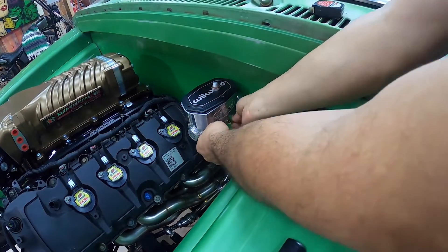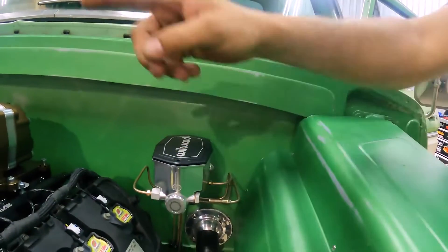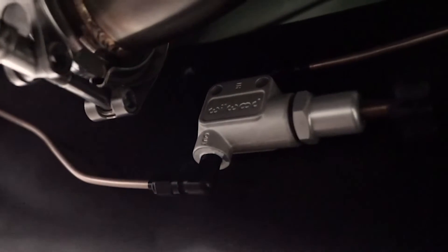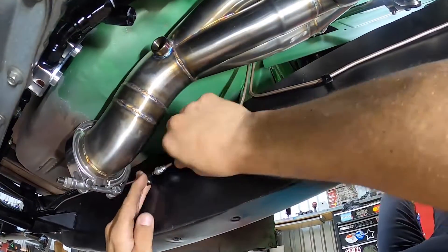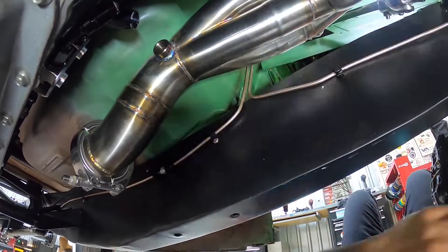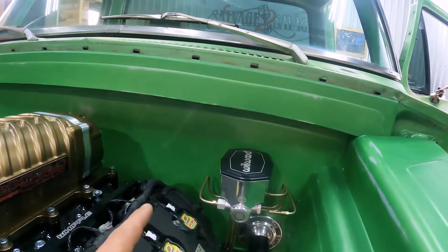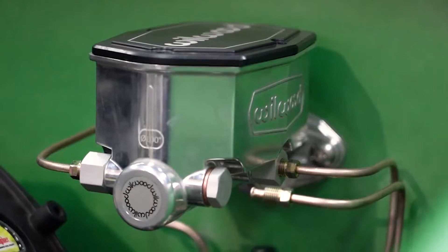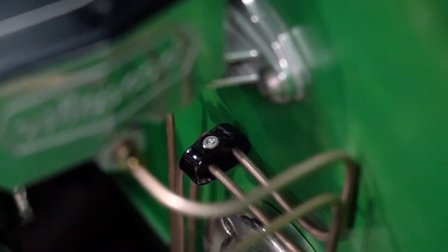Andrew's been diving deep into the brakes. We have our master cylinder from Wilwood that we bolted up on the firewall. We have each individual front caliper plumbed into the front of the master cylinder, and we're going to put a brake proportioning valve in the rear line so we can dial in the brake pressure for the rear. Those lines look really good against that firewall. If you want a quick refresher on how to bend brake lines, click the link below for our brake line episode. We have some clamps to keep the lines nice and tidy.